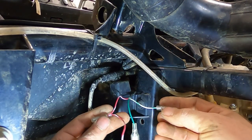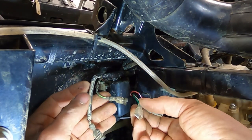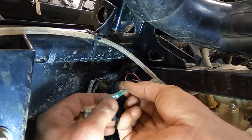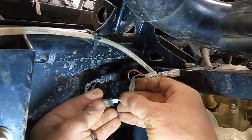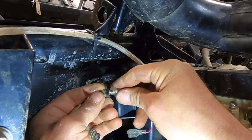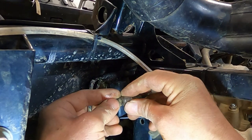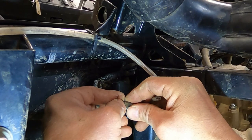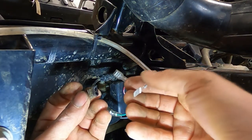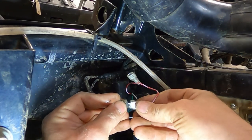Here's how this one works: here is the green wire — according to the instructions, the Power Commander green wire goes to the stock green and yellow wire, which is this one. So we'll get that plugged in. Like I said, this connector is going to be a bit of a pain. I've still got plenty of dielectric grease in there so we're not going to slop it up anymore. Let's get that inside there. Now I've got to get these guys over and plugged into our ignition coil.